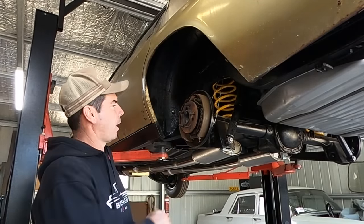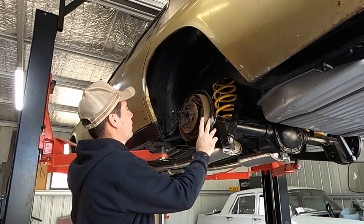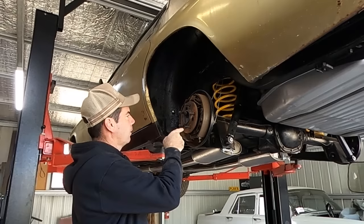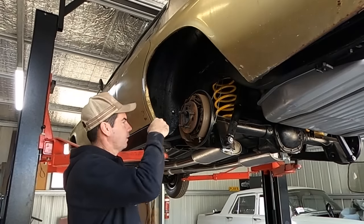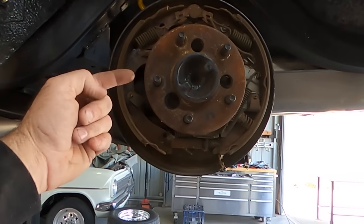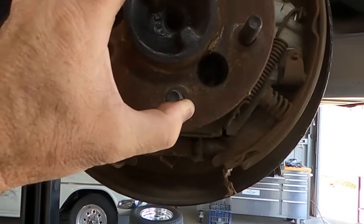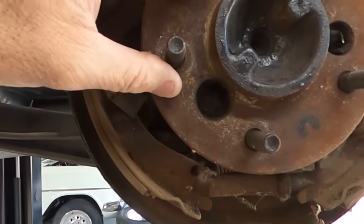And to get these backing plates here off, because I need all these, the backing drums, the axle's got to come out. So pulling the axles out, come over here, I'll show you. To pull these axles, there's a flange behind the axle, and that's what these holes are. A bit hard to see on this side. Maybe I should go the other side.